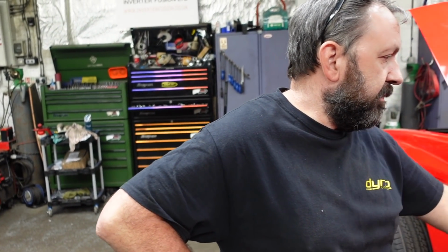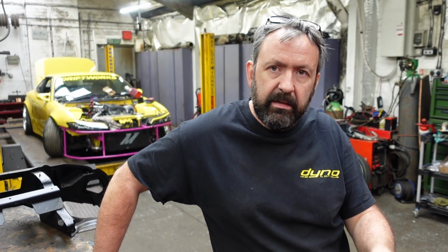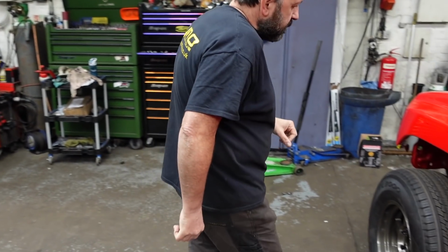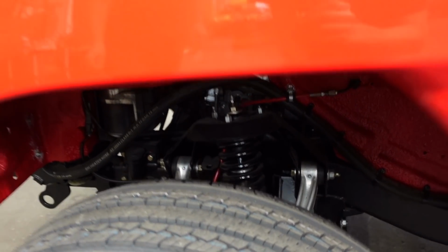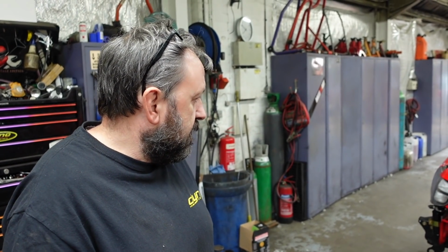So that should work. I think I need to go up on the spring rate on the front. The aftermarket springs are 12.9 kgs, but if you look at the front with the 12 on, it's fairly compressed. Is that a big fat engine? Yeah, a big fat pig in the front. If you look at the front springs on it originally, they're a proper beefy thing. Because it's much bigger diameter, it needs a stiffer spring, or a thicker wire. So I think I want to go up on the front. The back's a bit high at the moment, so I need to come down at the back.